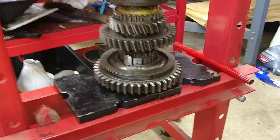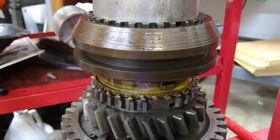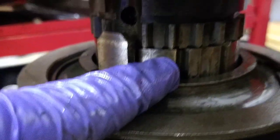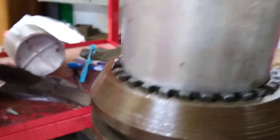I've got the main shaft in the press. I took the clutch cone off and put the old springs back in, so everything's in there. The shaft is resting on the press plates — the thick hub piece goes all the way down to the bottom, sitting on the press plates, and then the thin part of the shaft is protruding down the bottom. The gear isn't holding anything up, it's the whole shaft.